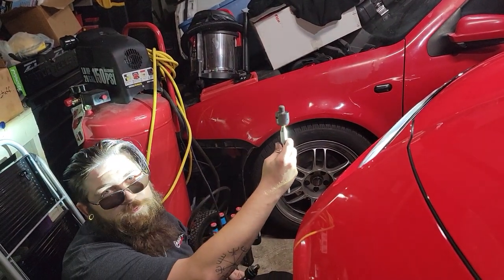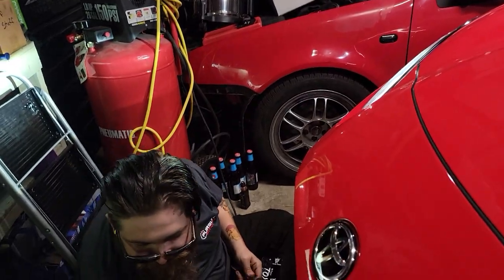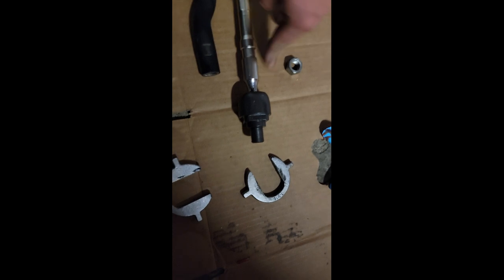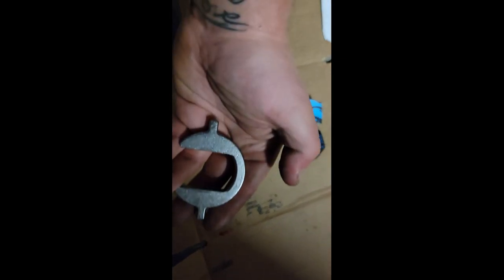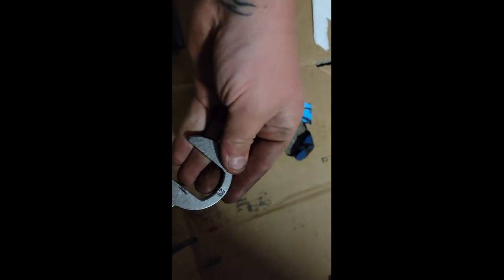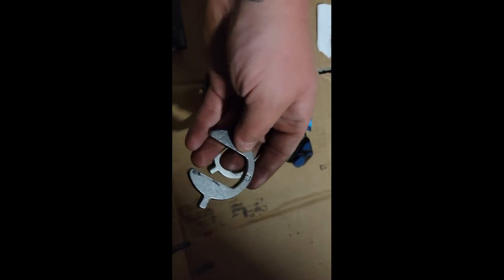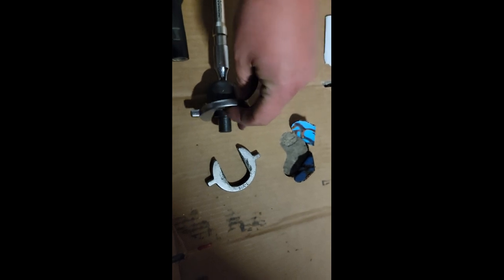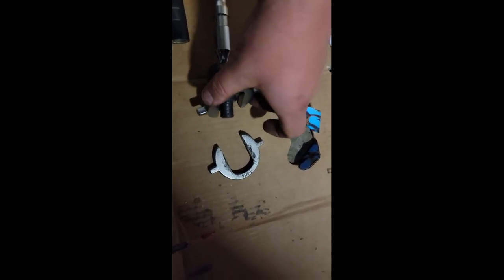And this is from Subaru, and Subaru sucks. For getting the Megan Racing inner tie rod on, it's going to be the 29 — if you get the loaner tool, I'm assuming that means 29 millimeter. It's a little bit big so it's probably actually a 28, but our kit's missing that.